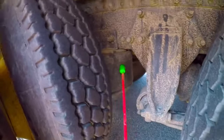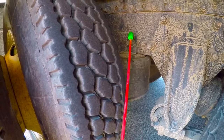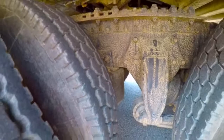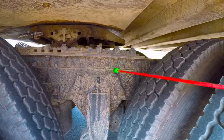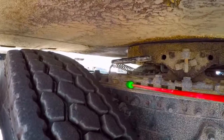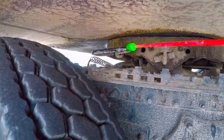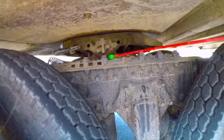The last part of my suspension I couldn't see from up front is this airbag. I want to make sure the airbag is not rubbing or chafing, not cut, not cracked or frayed or split, and that the mounts are securely mounted to the tractor frame, with the lower mount in its proper position supporting the airbag and the suspension. Also from here is a good place for me to inspect my fifth wheel. I can see there's no gap between the upper and lower fifth wheel. My fifth wheel mounting platform is securely bolted to the frame with no missing hardware. My sliding fifth wheel track is bolted in place — bolts are all there, nothing loose, nothing missing. My locking pins for the sliding fifth wheel are in a locked position. This is my sliding fifth wheel handle and it's in the retracted and locked position. And this is my pivot pin with a retaining pin in front of it to keep it in place.